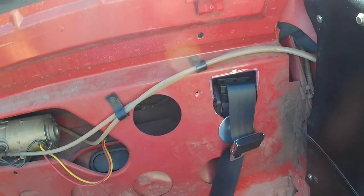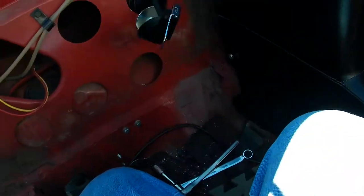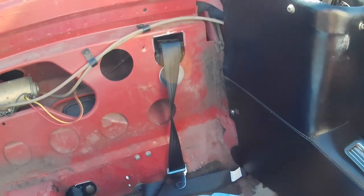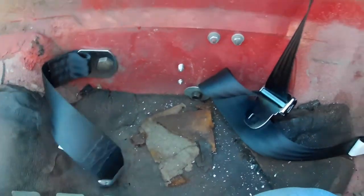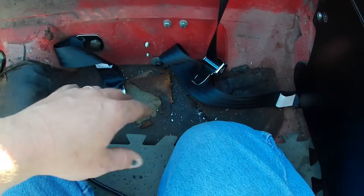I'm going to go ahead and remove the old seatbelts. This is the original lap belt bolted in here and here. I'm going to remove the old seatbelt, use the same hardware hopefully, and buckle the other end of this same apparatus here — then on this side. I got them all three bolted up now. You saw how I did that one — I took out the original strap on this side. You can see the angle that I had to put the bracket on to get it to fit in there, and then same thing on this side — put the buckle on this side, and you can see the angle I'm using here to get it to lay hopefully nice and flat on your lap.